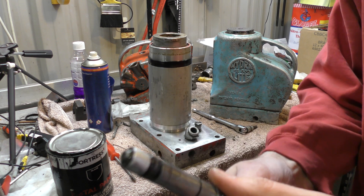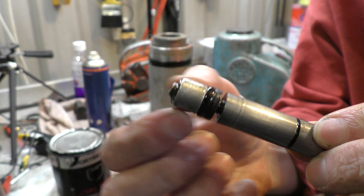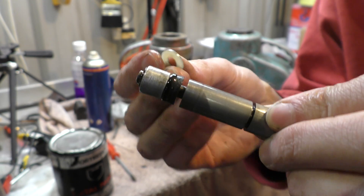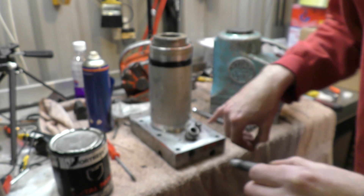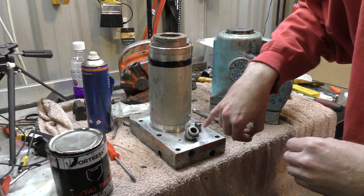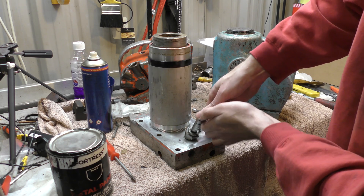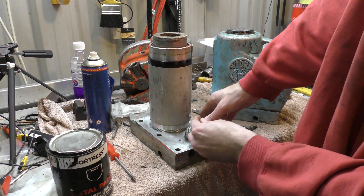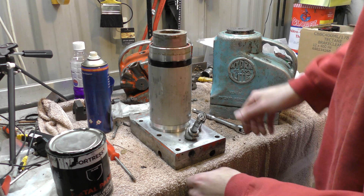What it was, was in here — there should be a fibre washer, I think it might be acrylic or nylon. But when I put it back on it no longer fits inside the hole, so I took it off and it now fits like it's supposed to — nice and tight but actually moves. And it'll pump up on hydraulics.